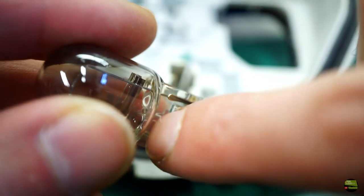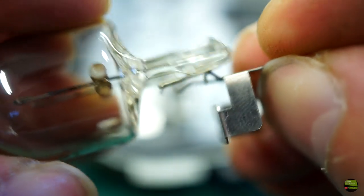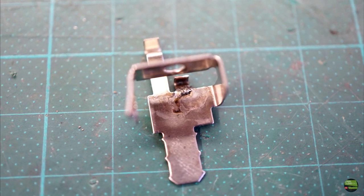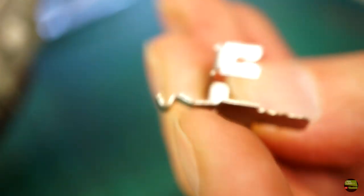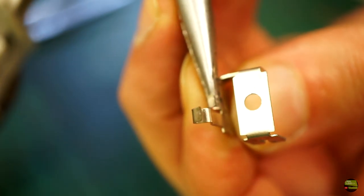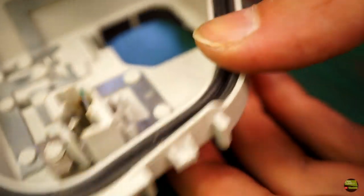This steel part has 2 similar hooks. The top one is just a hook for the bulb groove and holds it in position. The lower, smaller one is for power distribution to the bulb. I cleaned the entire part with a rotary steel brush to remove all traces of burnt plastic. Now I align the hook so it fits tight to the line and makes good contact. If you're unsure about that spot it can be soldered easily, but I didn't see the need. To fix the burnt contact, I just held it with tiny pliers and tilted it outward, then increased the radius a bit. By doing that I achieve two things: the force pushing to the bulb wire is bigger, and I get healthy material on the spot where it touches the bulb wire.